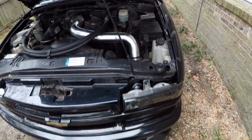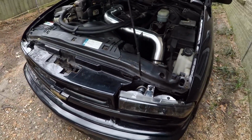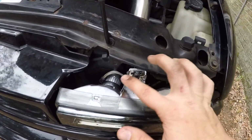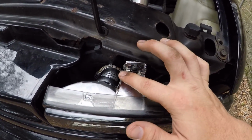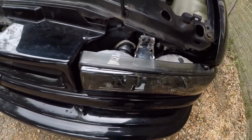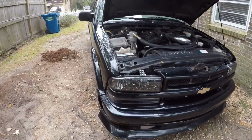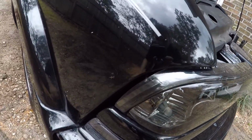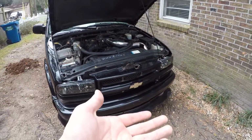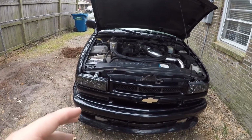On the original headlights, it kind of stopped right about here. So I just took a heating iron that I used for plastic welding, and I basically just set the iron on there and let it grind down, and the hood shuts perfectly. You will have to do some adjusting. You can see this one's pretty much perfect. The body lines are pretty much on par with the stock headlights. This is why you might want to do one at a time if yours are already perfect.